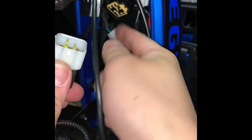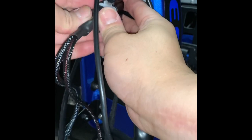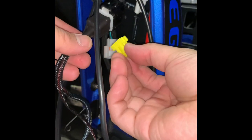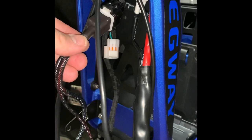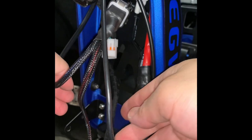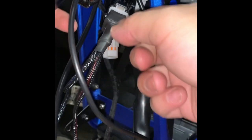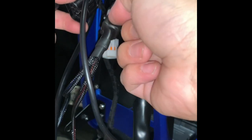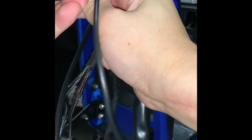It's a little tricky because there's a lock on this connector. I managed to press this connector pretty securely — I had to remove this lock on the connector on the BAC harness, but it's not a big deal. Now I'll reconnect this — I accidentally put this connector through the hole, so I have to back it out and move it under here. Once I reconnect it until it clicks securely and pull on it, if it's not coming out, that's how you know it's secure.